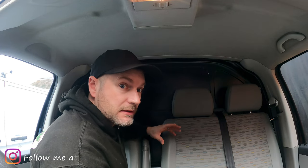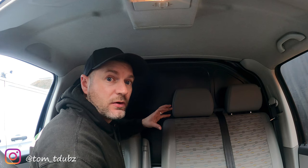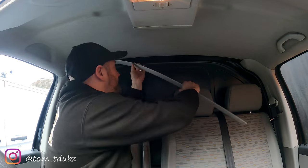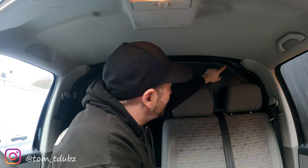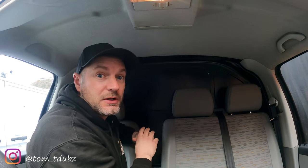First thing we're gonna do while we're at the front of the bus rather than going into the back to start with — I know some of you will be like, just get straight in the back and undo all the bolts, yeah, why is it not coming off? Underneath this panel here, which I'm just gonna dash on the floor, is one, two, three, four torx screws, and what you want to do to start with is take them out. So when you've done all the bolts in the inside the van, which we're going to go and do in a second, you'll be able to remove the first top bit without having to climb back into the front. So you might as well start in the front — it speeds the job up.